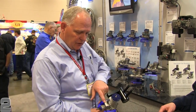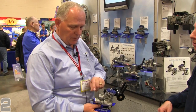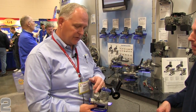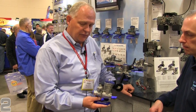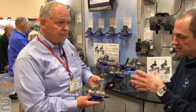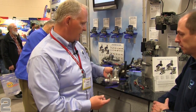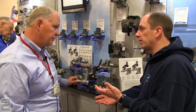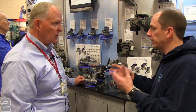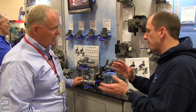The three smaller engines use a unique almost glow-style carburetor. They all use muffler pressure — it's not a pumper carb; there wasn't enough room to put a pump on it. But there is a regulator on the front of all three carbs, so you run muffler pressure, it gets the fuel there, and then it's regulated. The carburetor controls are similar to what you're used to on glow engines: high-speed needle and low-speed needle. No confusion — nothing different as far as setting the engine. Evolution is known for a very simplified break-in process: very little adjustment out of the box, and very little carb or needle adjustment through the break-in period.